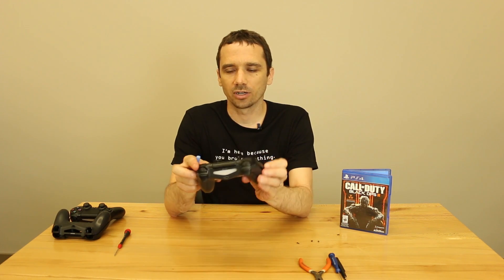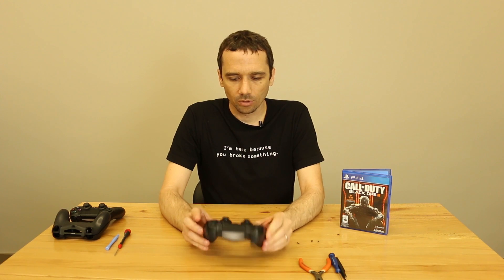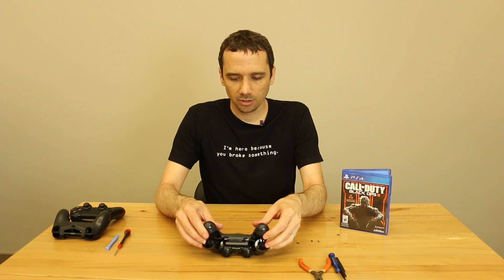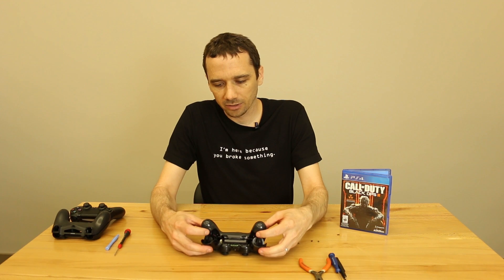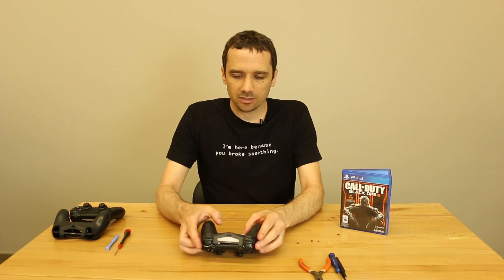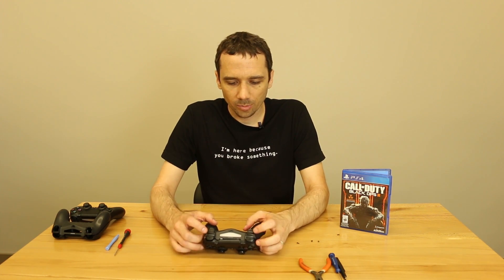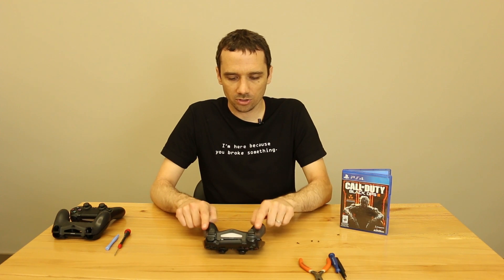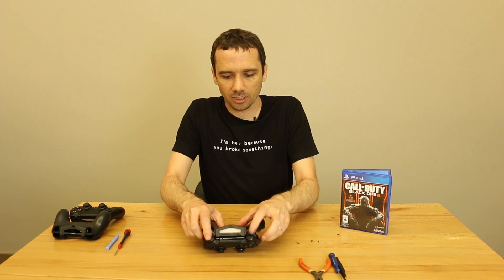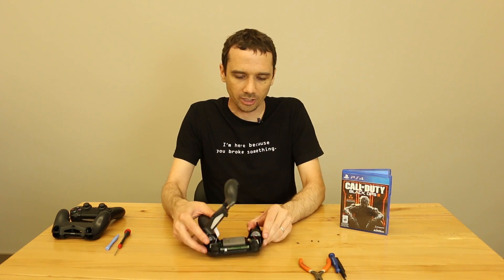We still got the front of it that needs to come off. I'm going to turn it over like this and pull this up until it kind of clears these long plastic pieces where the screws go. Now that that's done, I'm going to flip it around and put my fingers right on the tops of these trigger buttons, then push the bottom case forward. As soon as I push that one forward far enough, it just pulled right out.